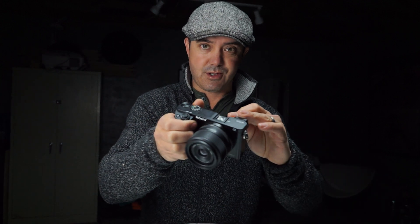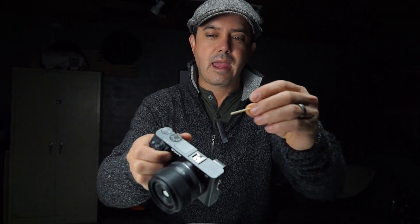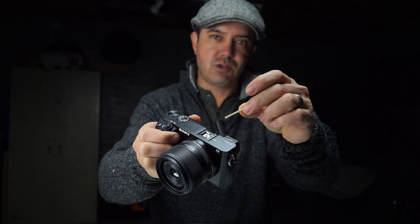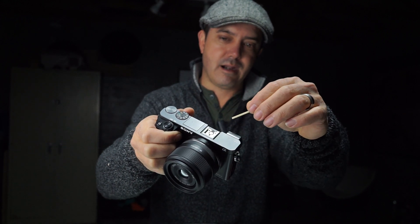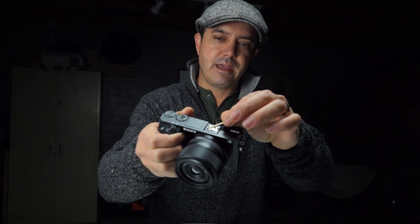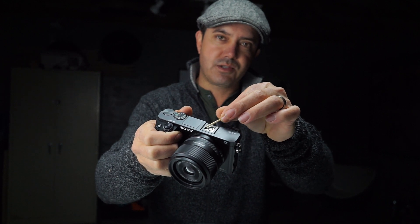In the past I've done a couple of videos on how to fix the Sony hot shoe, because the a6000 hot shoe is very buggy. I imagine it's buggy on the RX1 and the RX1R as well — those look like they might have the same issue. You remove the paint out of the hot shoe and that gives you a better connection. I did one video where I removed the paint entirely. A lot of you were concerned about the warranty, so if you remove the paint from just the rails and the springs up here, that also seems to work.